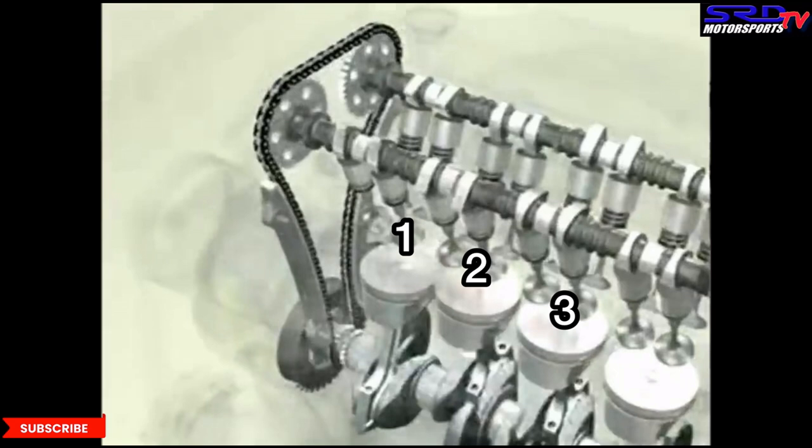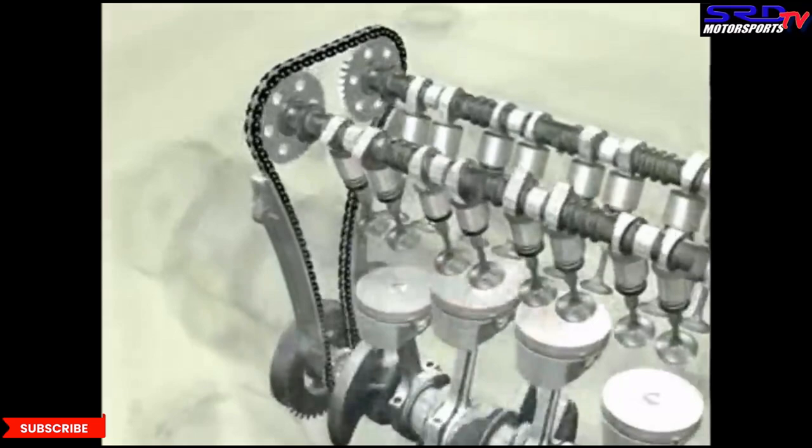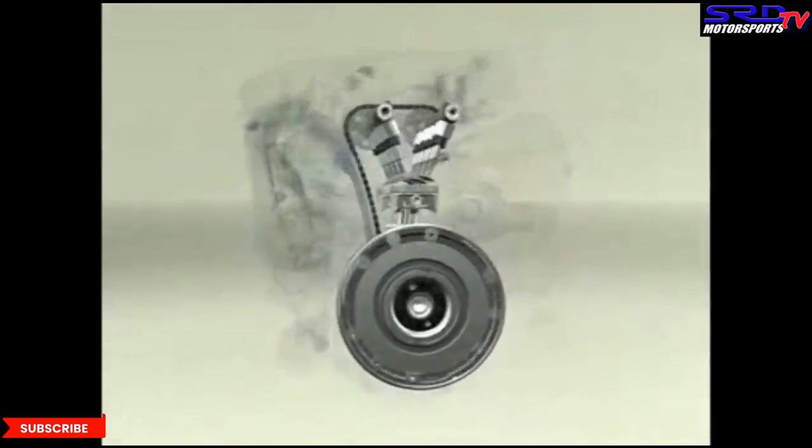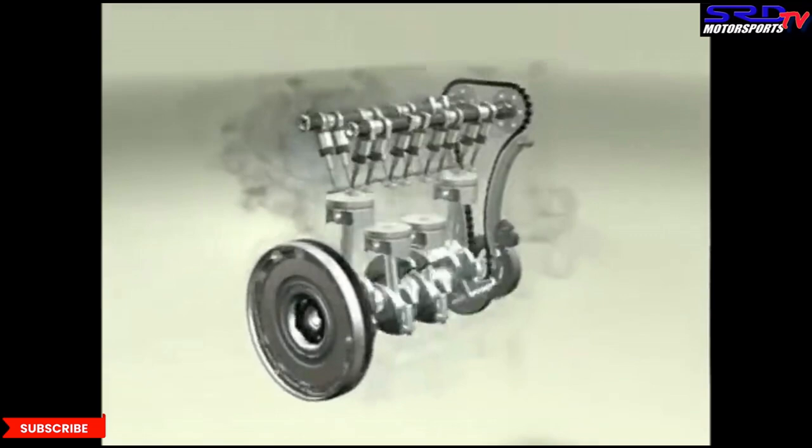To visualize better what we're talking about, let's look at pistons one, two, three, and four. Remember the numbers so when the graphic starts moving you already know which is which. When you think about it, there's a volume of air underneath the crankcase below the pistons — as long as there's volumetric area, there's air. As pistons go down they push air beneath them to the other areas. As pistons one and four go down, they push the volume of air beneath toward two and three, and since two and three are going up, that makes it okay.